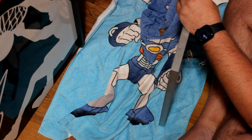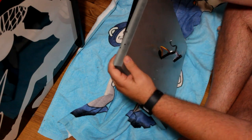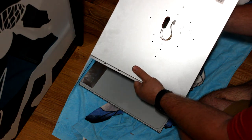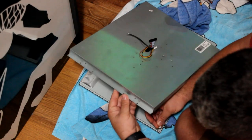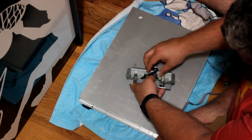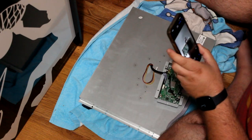You have to unscrew the monitor to decase it even from the Arcade 1-Up case. There's a metal case that fits into the cabinet. We want to get the old Arcade 1-Up monitor out and get the new monitor into that case. Be very careful with that cable — it's going to connect right into the new monitor. Slide these cables through carefully, as that is sharp metal going through. The connections are the exact same as before with the new monitor, so it's basically plug and play. Really be careful where the red wire connects — you don't want this to catch fire. There is a little bit of risk with doing this.